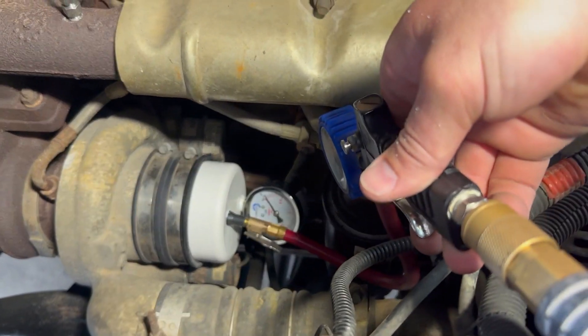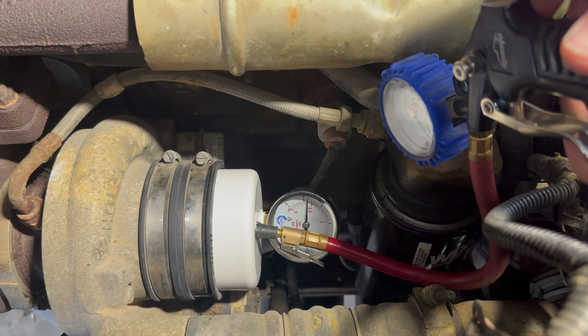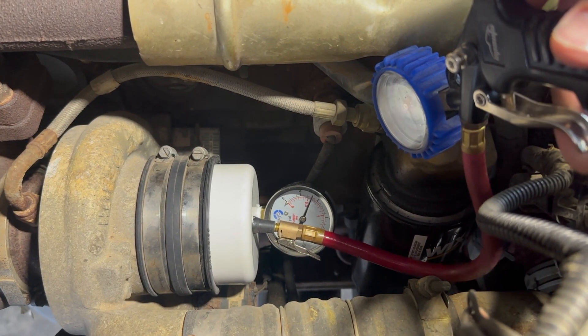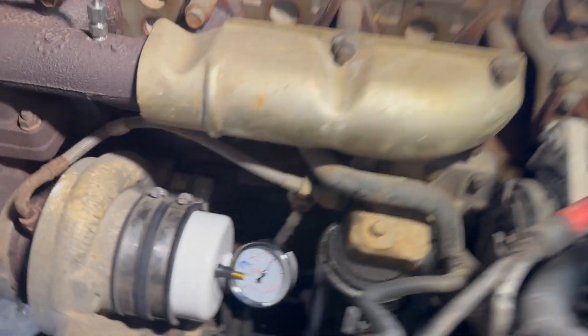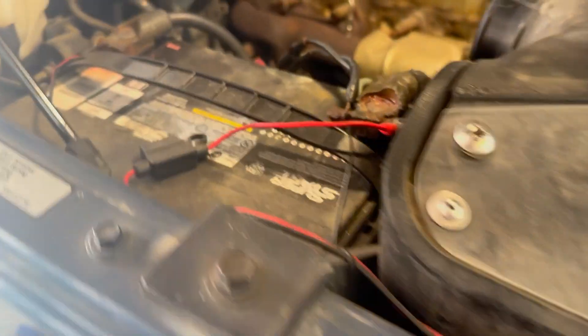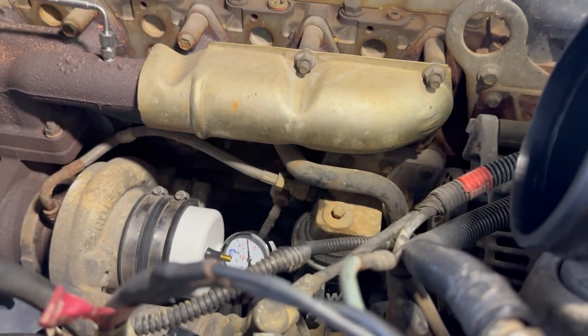Now I've got the little rig on there and we can start adding pressure to it. I'm going to try to bring it up to around 10 to 15 pounds and let it hang out there for a second. You can spray everything down with soapy water if you want, but you should be able to just be quiet and listen. You are going to lose a little pressure just because it's going to be seeping past the rings, but you should get a pretty distinct hiss if any of these couplers are leaking. And I hear nothing, which is good. It is going to bleed down, which it has, but it should give you enough time to listen. I'm going to try to pump it up just a little more.